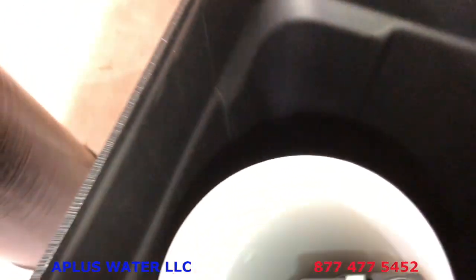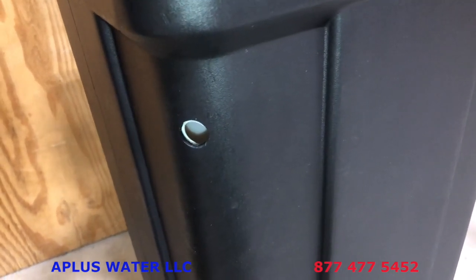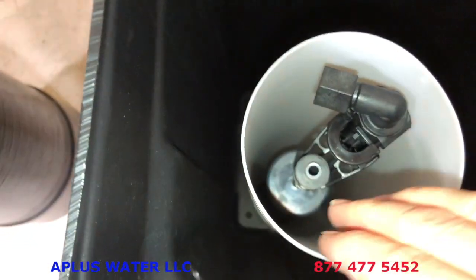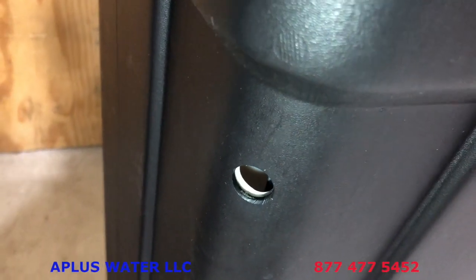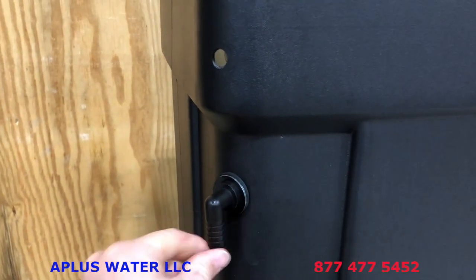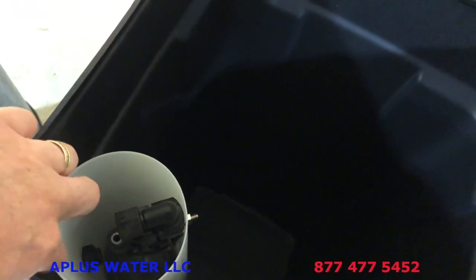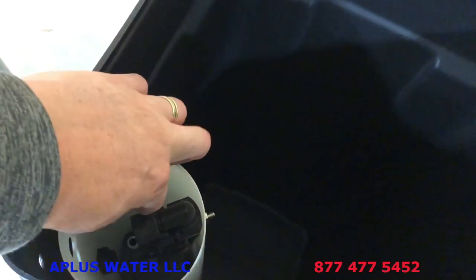The stainless steel side goes through there with a little stainless nut — that's how you hold the safety float to the brine well. To connect the brine well, the two holes are gonna line up with the outside of your tank. You're gonna put your overflow elbow through there — just move the elbow aside, hold the nut on the inside, line it up, put the male threads through, and snug it up. If you had a hard time putting your hand in there to hold it, you can take the nut off, pull the float out, put in the overflow elbow, then drop the float back in.